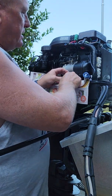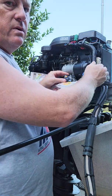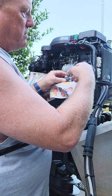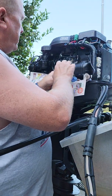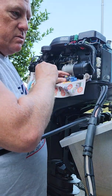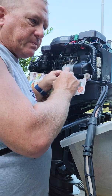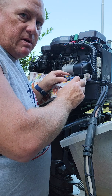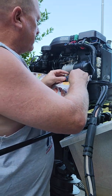It's sending a mixed message to your ECU, so it's causing your fuel-air mixture to be messed up, which is causing your fuel rail to expel a lot of gas into your spark plugs, which is causing them to foul out. Which was giving me my problem also.